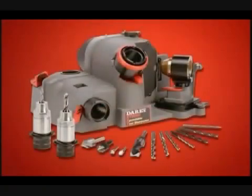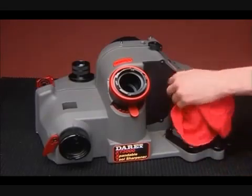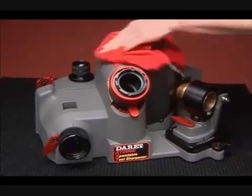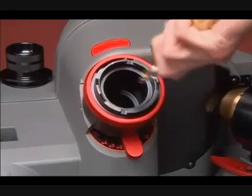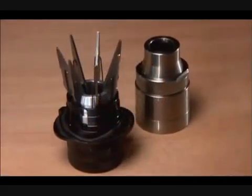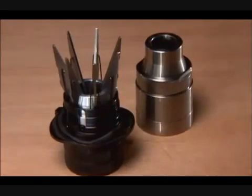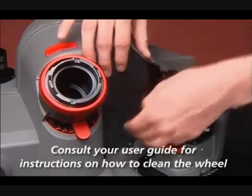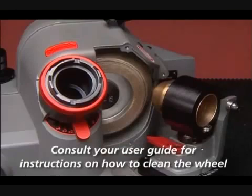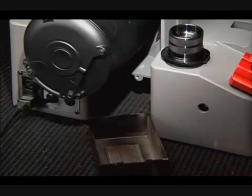Maintenance and Cleaning. Your Derex is a precision tool and should be cleaned regularly to remove dust and grit that can wear down the ports and the chucks. The cleaning process takes about 5 minutes and will help maintain optimal performance. You will need to clean the chuck, the alignment port, the sharpening wheel area, the sharpening port, and the splitting port. Unplug your Derex before beginning. Use a dry cloth, a 1-inch vacuum hose, or compressed air to remove dust particles from all ports and the sharpening area. To clean the chuck, blow compressed air through it from the knob end; if needed, consult your user's guide to take the chuck apart for thorough cleaning. The sharpening wheel will need to be cleaned and occasionally replaced — to change the wheel, remove the cover, unscrew, and replace with a new wheel. You will also need to empty the grit tray, located in the back of your machine.